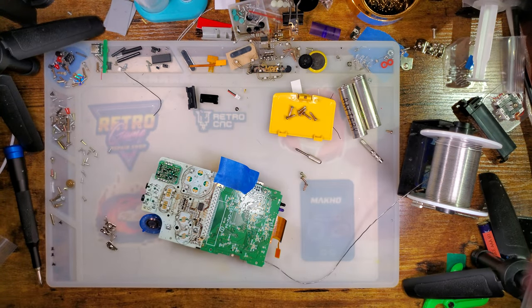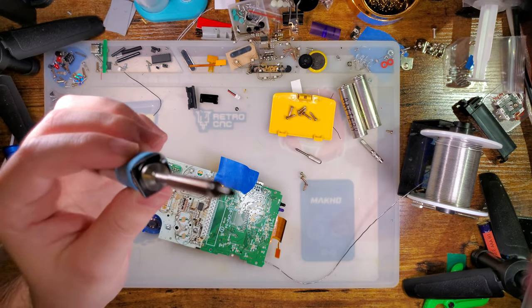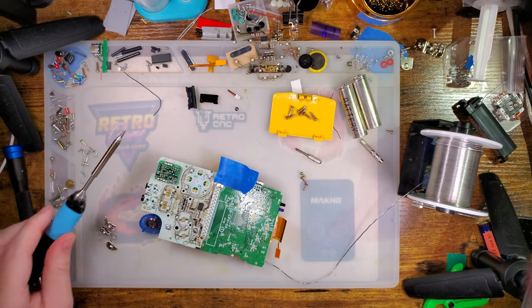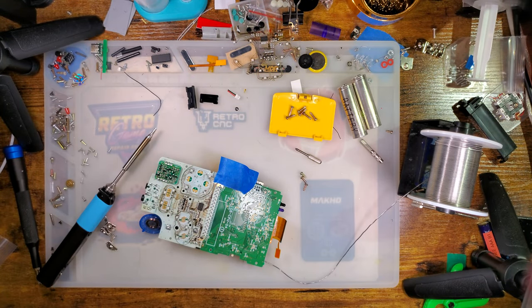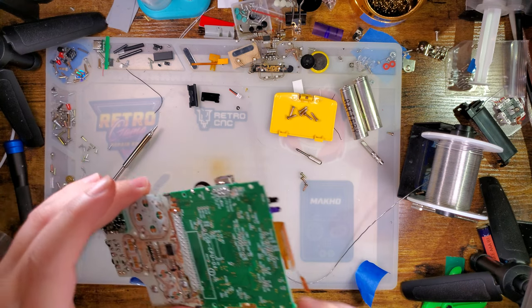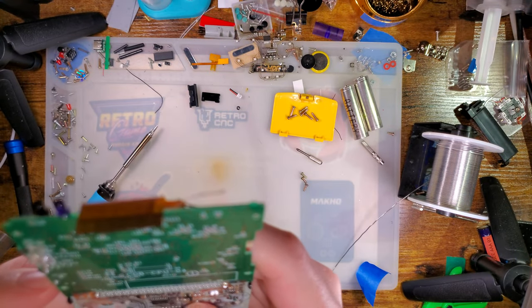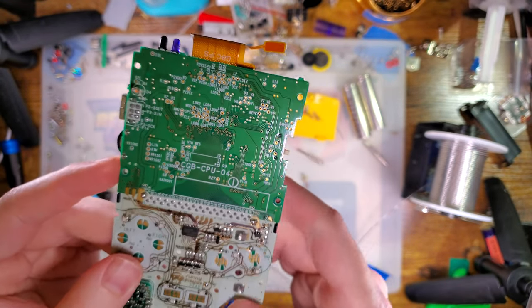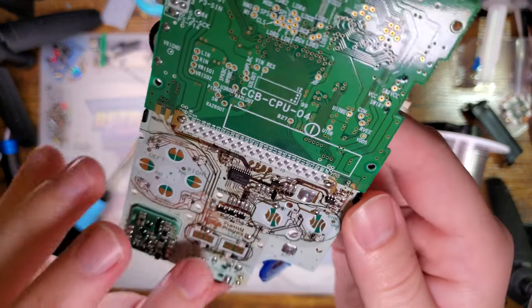This was definitely a much easier tip to use, though. It's the little cup tip for drag soldering. I forget what they're called. Luckily, I started with the pad that does not matter, so the fact that I totally ruined that pad is going to be irrelevant for this install. But feels like I got the rest. Quick in and out with some solder, move on.